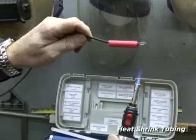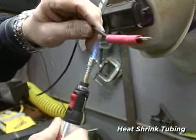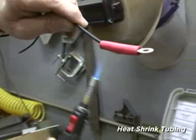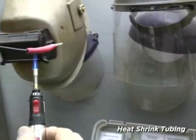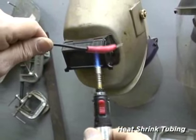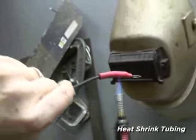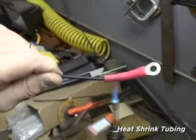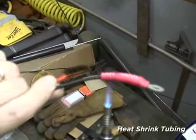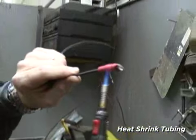This is how you do it with shrink tubing. First of all, please move your fingers back from the line — I've made the mistake enough times of forgetting to do just that. Keep moving, don't burn. You notice how it is shrinking and self-fusing itself over top of that old fitting. Now you notice out at the edge, a little bit of moisture is starting to show. That moisture is an adhesive coating inside of the shrink tubing that gives you your moisture seal. Always get your adhesive working first — that way you know your ends are sealed.